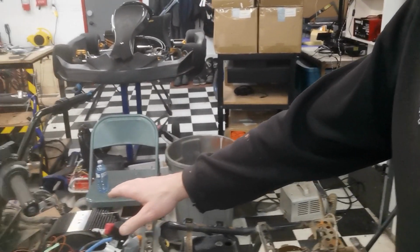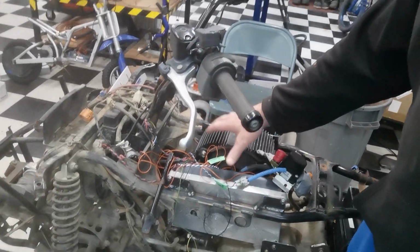And then, like I said originally, I kind of designed it for where the gas tank is to hopefully fit a battery under there if I need to. So I might be able to have room for 3 Zero packs like I use in my Zero MX. So that should help it rip pretty good. I think 2 packs will be enough. I don't really need the full 680 amps going out of the batteries. I can limit the battery current to maybe 400 amps and limit the horsepower down a little bit.